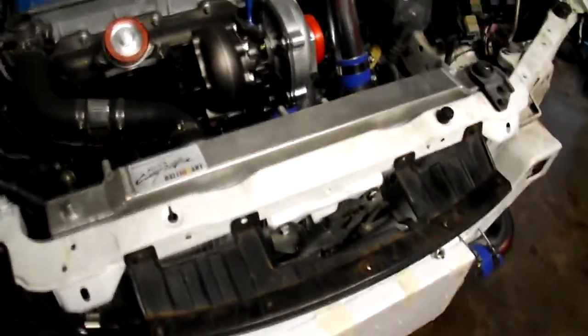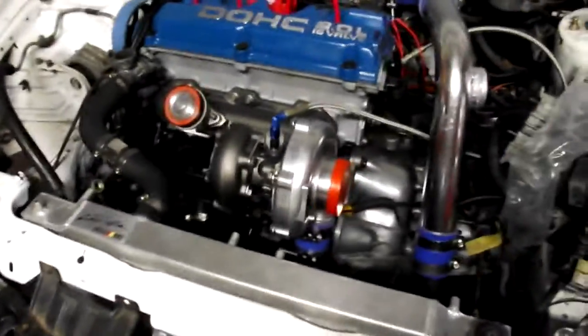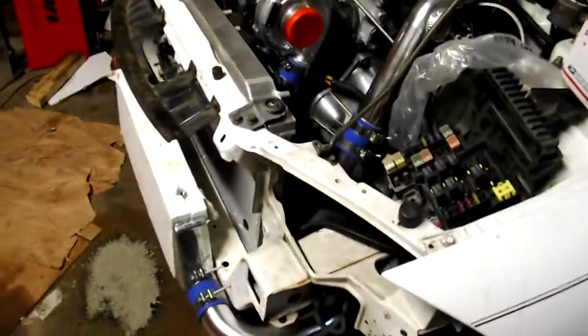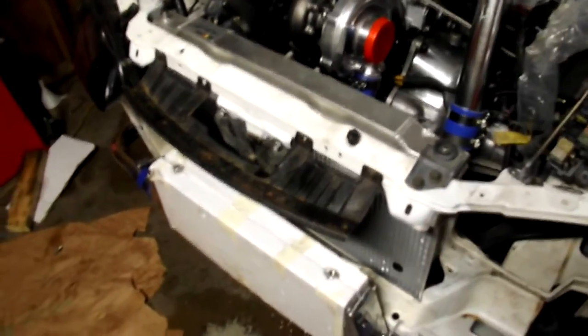I'm very happy with the way it went. The install probably took — I can't really tell you how long it took because I actually put the Neon water inlet on the engine while it was sitting on the engine stand. This has been Nitro Kid 98. Hopefully this will solve some of y'all's cooling problems. Go on eBay and buy a 1G turbo radiator. If you have any problems bolting this thing up, just hit me up on YouTube and I'll walk you through it.